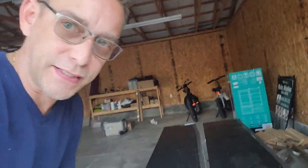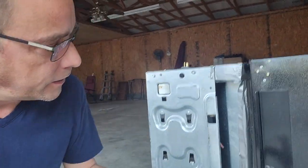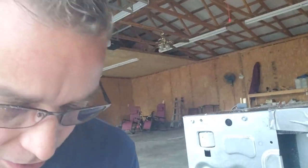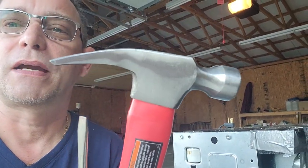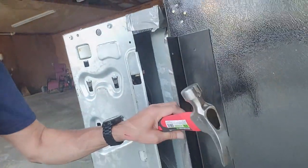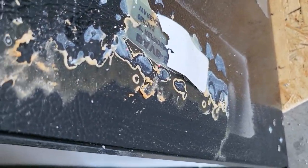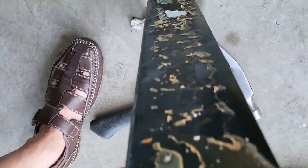I just remembered something — I might need this top upper bracket off this fridge because it doesn't come standard on fridges. They just add these when installing them in an RV. You can see this bracket right here — notice no screws in it. Guys, I can't stress this enough: don't screw into your refrigerator. Use two-part epoxy or something made for metals. Don't make the same mistake I did. I'm going to use a hammer and screwdriver to get underneath here and get this off — they didn't screw it in, they just used some sort of epoxy to attach it, so we'll just have to clean that part up.